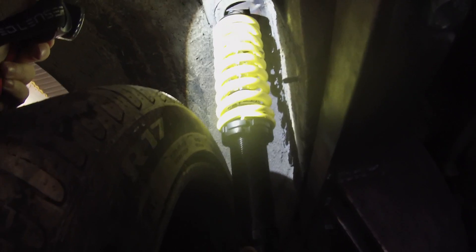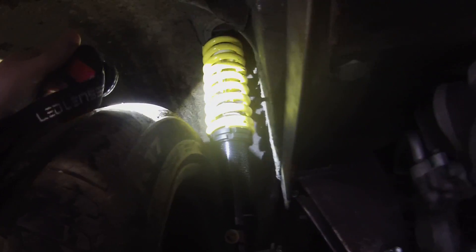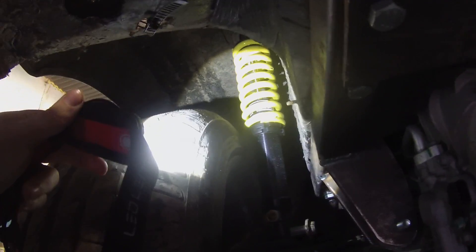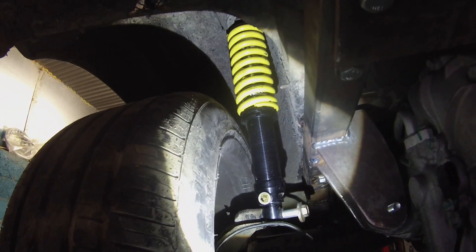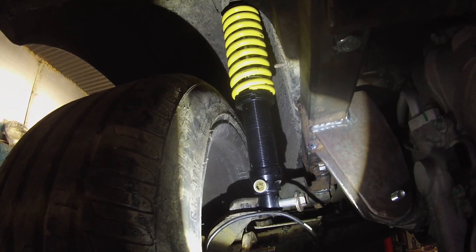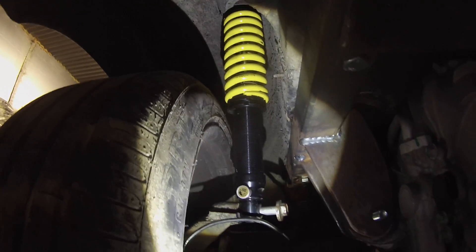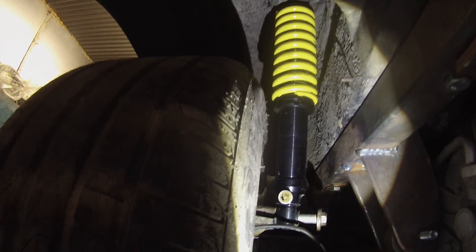We do need the helper spring so we can drop the car down a bit. I was looking for a longer spring with a 500 pound rating, but sadly they're not available off the shelf, and none of the custom spring companies want to talk to me. So if anyone does know a good source of maybe 10 or 11 inch, 500 pound rate, 1.9 inch inside diameter helper springs, do drop me a message.